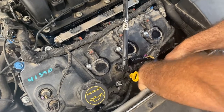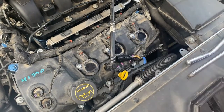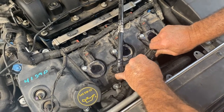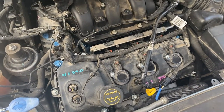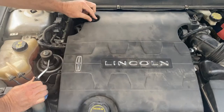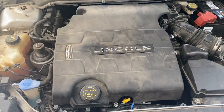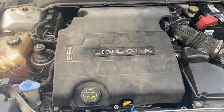Get the tool out and try not to drop it, otherwise you've got to go look for it. I've got that out of there. I'm going to run the wire on the other side like that, put it up, and plug it in — you've just got to listen for it to click. That's installed. We've just got to put our cover back. Slide that around, line this clip up, put that in, push it in place. That's all it takes to do a Bank 2 Sensor 1 oxygen sensor on a 2014 Lincoln MKZ with a 3.7 motor. Thank you.